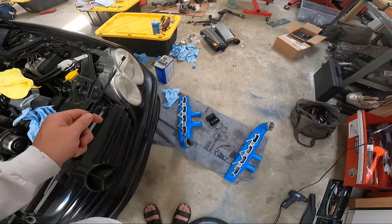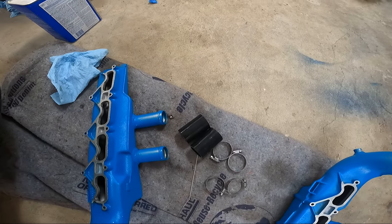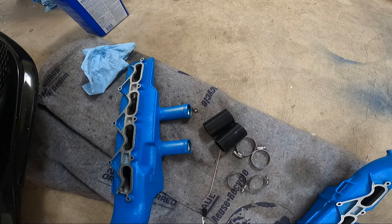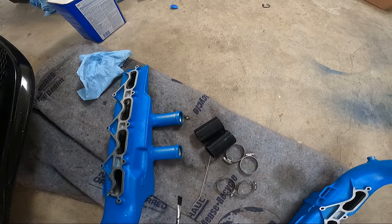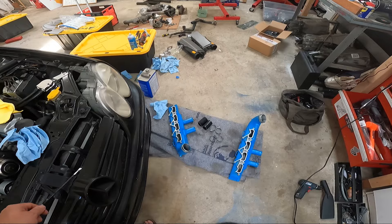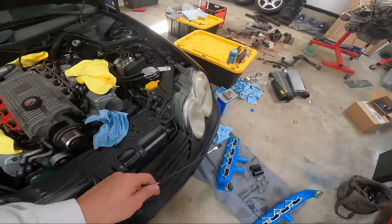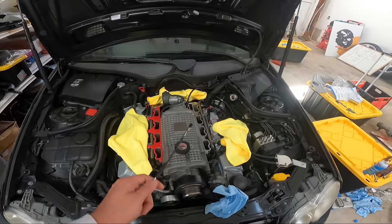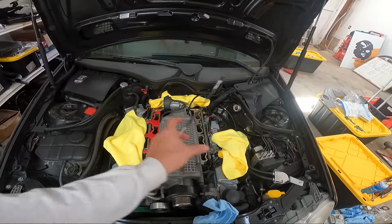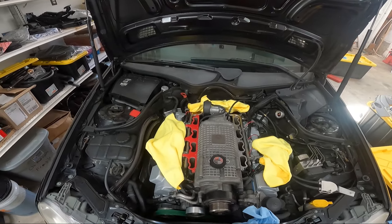Surge tanks going on. These were quite sticky getting the silicone couplers off, so I'm going to put some grease on them this time to make them easy to slide. I literally had to stand on one of them and rip them apart because they were so stuck together. So basically to install those, I'll do one at a time, put the couplers on, the clamps, then install the other ones and slide everything over to join them. It's gonna be a process, but let's get it done.